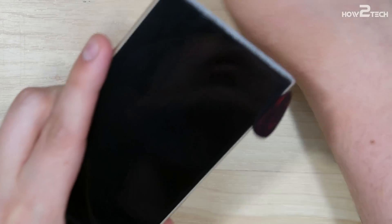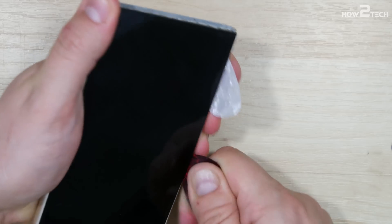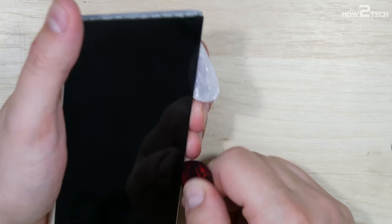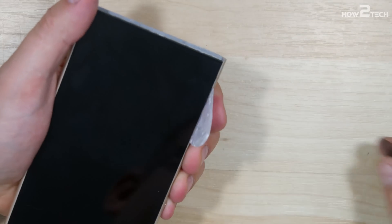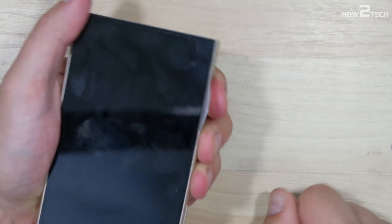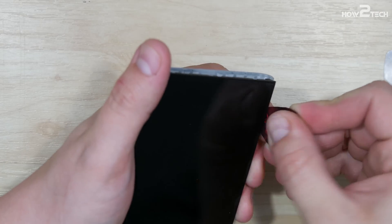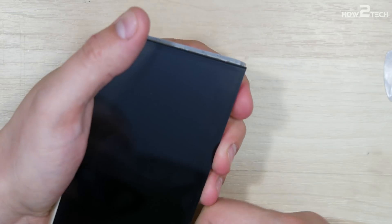The portion that clicks into the midframe is at the very bottom of the display frame. So we're just going to take our tools and work our way up the side, using one lower to create pressure, putting another one in and then pulling up on it. I'm using the thinnest guitar picks that you can find — they're a little bit flimsy, but they'll do the job. You just have to push them up and down a few times to get them to unclip. We've made pretty good progress; you can see that we've got a lot of clips out. I can put my pry tool in and flip it sideways, then start working on the opposite side.